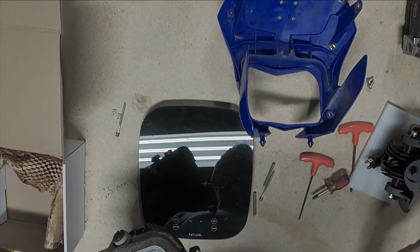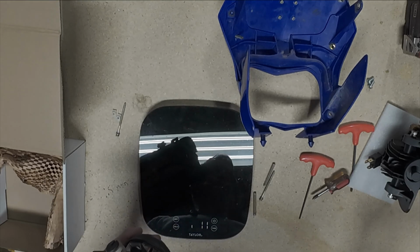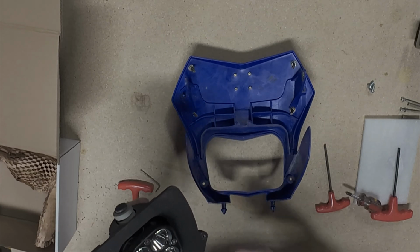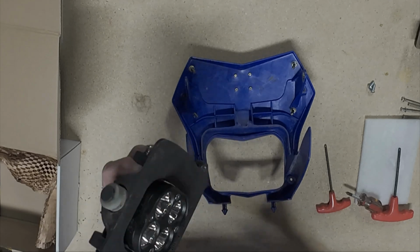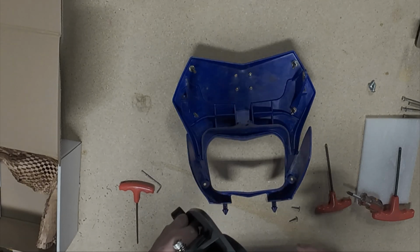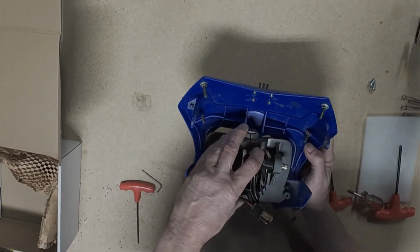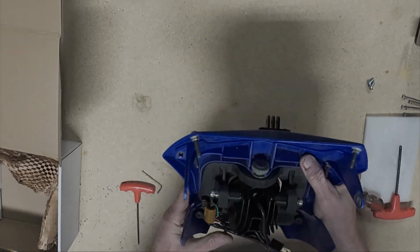All right, let's go ahead and get the Flight 4 headlight insert into the shroud. So what you're gonna do is once you get these two screws pulled out of the headlight mounting frame, you're gonna go ahead and take your grommet. Make sure you put the grommet on. It splits. Come through here, go up to the top, work the headlight on. Boom, right there.